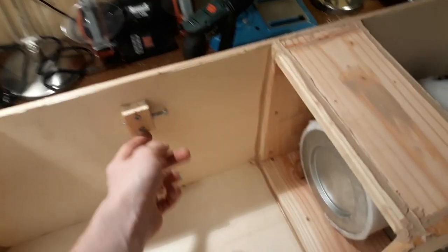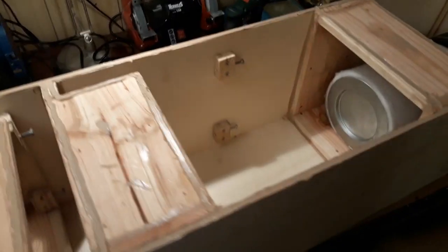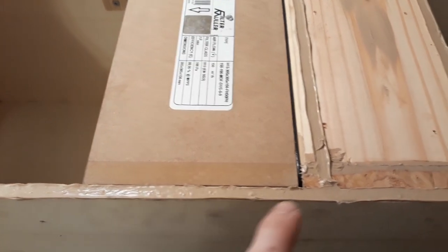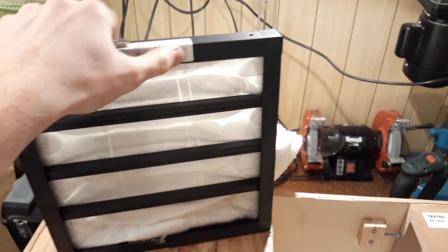So I'm just going to put in the filters. We've got these little screws here — when tightened, they press the filter against these seats, and this should seal everything up. The filter here will be pressed by the front plate. Now for sealing some of the filters, I've got this kind of foam tape which, when compressed, just seals it very tightly. The big H13 filter has some kind of silicone on it per factory, so that actually wasn't necessary on this filter. But on these ones it is, because they just have this kind of plastic shell here, so we need to seal this up.